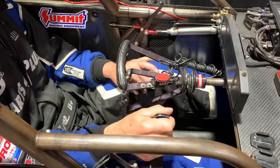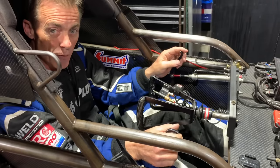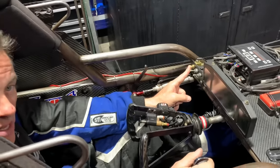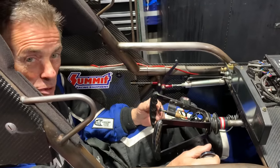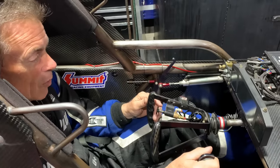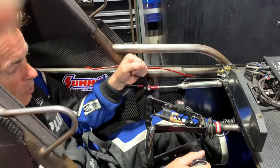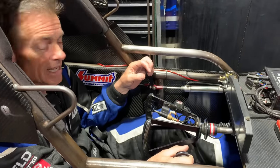I'm holding the brake pretty hard and just waiting for them to make adjustments — they're mainly looking at engine RPM. At that point they'll tell me to pull forward. I'll roll forward, constantly checking to make sure my fuel flow number is correct. Once I pull forward, I actually charge the clutch system again — I push this button which puts the throwout bearing in position for a run. Once the crew chief gives me the wave in, I close my visor on the helmet, work the clutch in and out again, turn the top stage bulb on, then reach over and pull the fuel all the way on.